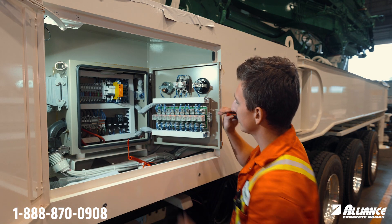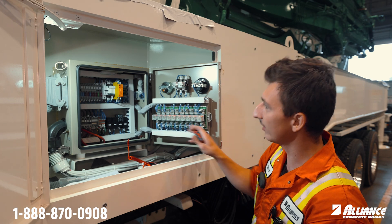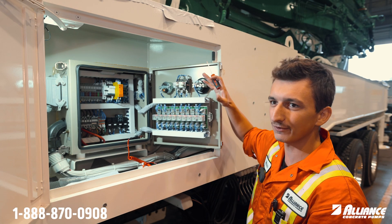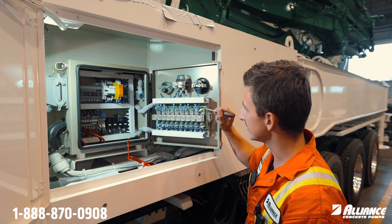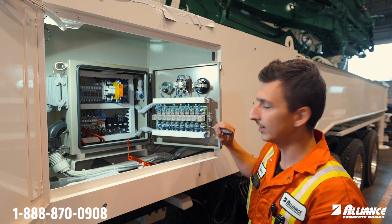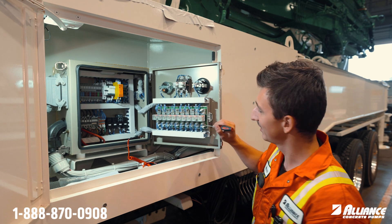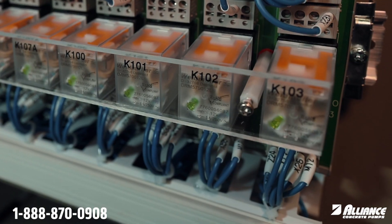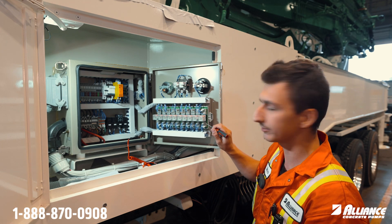For this we're just gonna talk about K103 — it applies to all these ice cube relays. These two up here are a little different but same idea. Starting off you can see we have one, two, three, four rows. Three sets of those have four columns and the one just below the relay is only two. What we have here is a trigger for the relay and a ground for the relay.